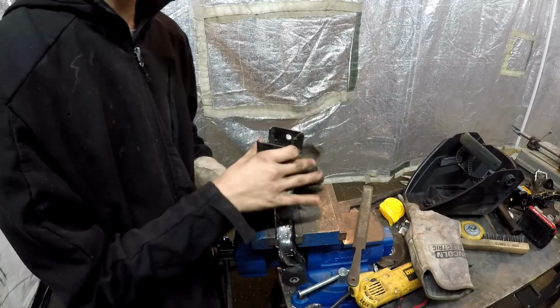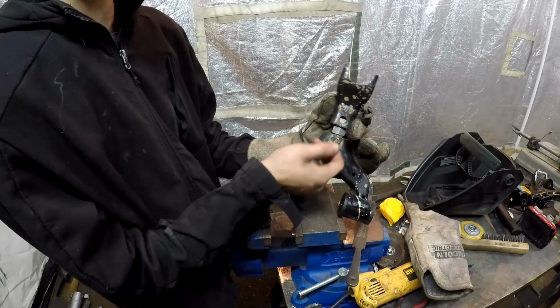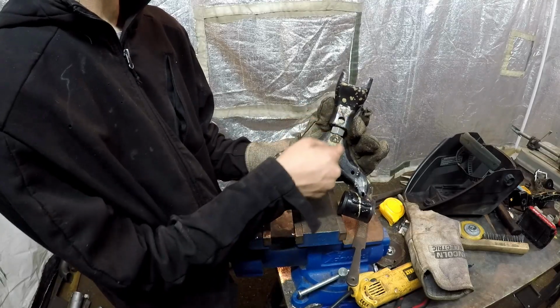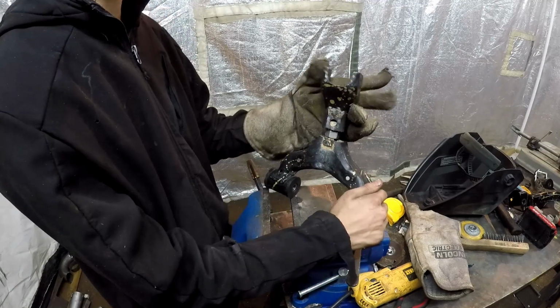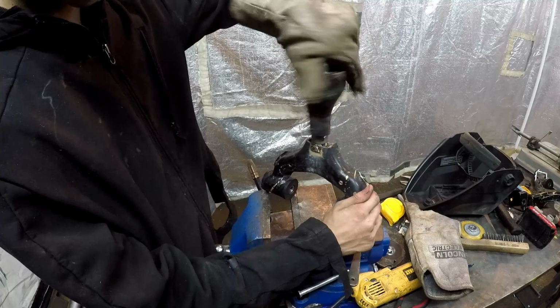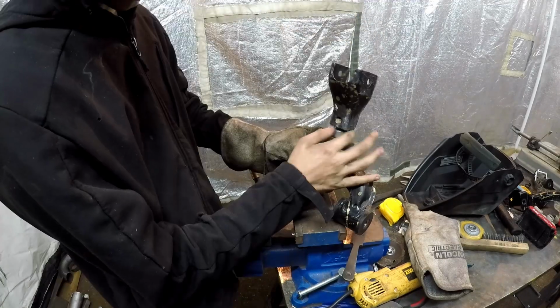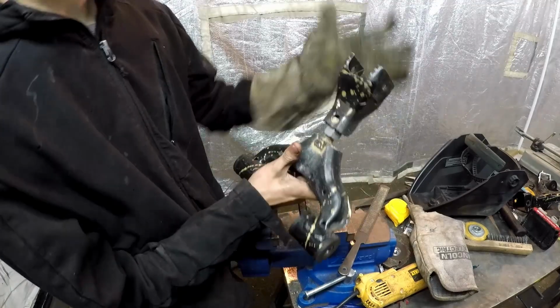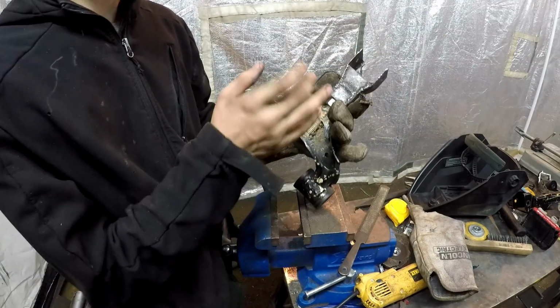And look at that, now we have our own camber arms. So we have our bolt through the middle, we have a nut on this side, and we have our bolt welded on through this side. And then we have this nut in the middle, so we get wherever we want. Let's say this evens us out perfectly. We go and tighten our nut to that point. And now with this top part being in the knuckle, and this being tight, that isn't going to go anywhere.